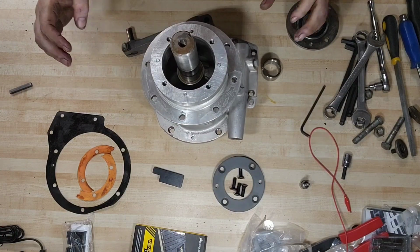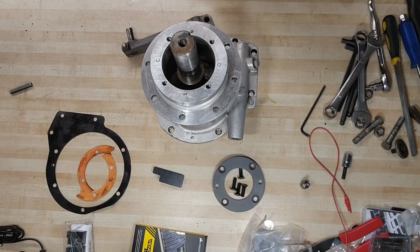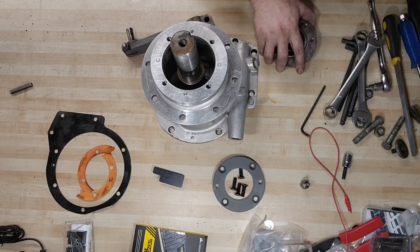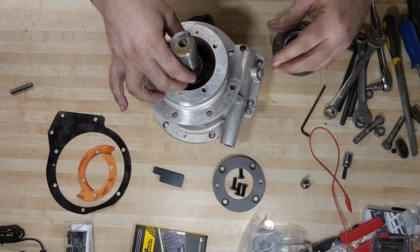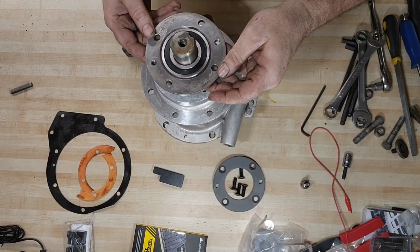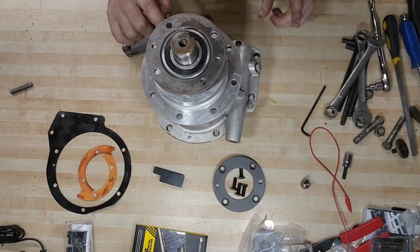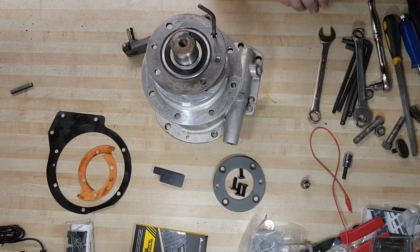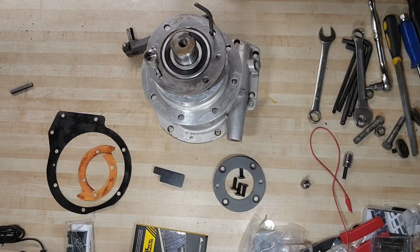And I forgot the spacer that goes on the shaft under the oil seal. That one's pretty chewed out. But what we're going to do, we're going to flip it around 180 degrees and put the non-grooved worn side away from the oil seal. So we'll have a fresh side facing. It's not the best thing in the world, but we don't have any extra parts for A2 machines. We're GS pinsetters, so all we can do is the best we can do here. And I put an Allen wrench in here just to kind of line the holes up a little bit while I start trying to press these or reassemble.